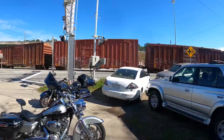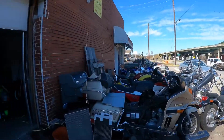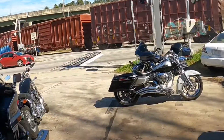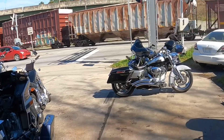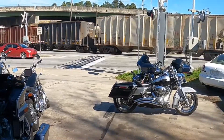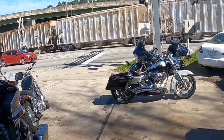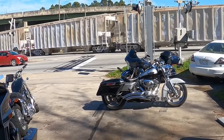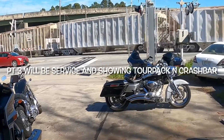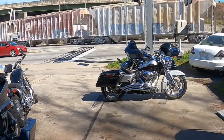Always a train when I'm filming. Anyway, one test rip around the neighborhood — let me tell you, it is a ripper, that there is no doubt. But I've got an event to go to at the local Harley shop — a cook-off type thing. So I'm going to take the road glide so I can put some more miles on this one and check everything. I just don't have enough time today. But I think, other than a couple little cosmetic things, mechanically it is done. I'll do a full service — spark plugs, full oil change, primary change, trans change, all that stuff. Super happy how that thing came out.